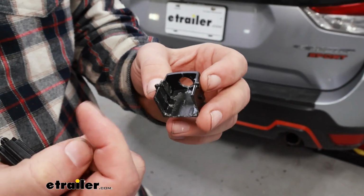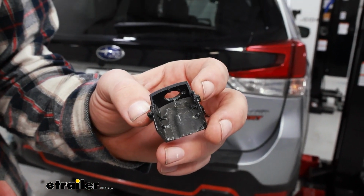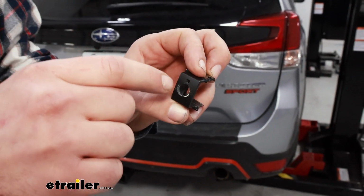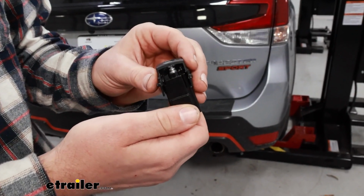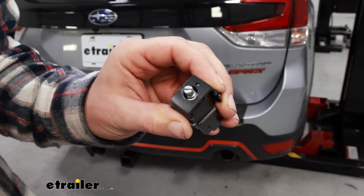I hollowed it out, just cut it with some clippers and then ground it down with a drill bit. Then I found center, drilled a 3/8 inch hole there and a smaller 1/8 inch hole up top. That's for the light. So we'll take our new switch, should slide right into place. Make sure you get the light lined up with that top hole.